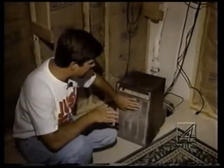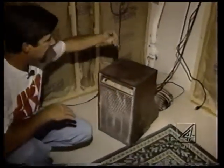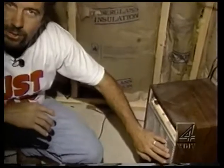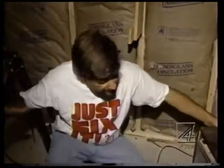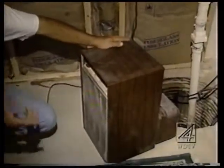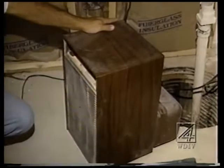The principle behind it is it's going to draw in air through the front, and it's going to drop the condensation in the back. We'll get into that. But first, I want to let you know, you need to clean these dehumidifiers every season, whether there's a filter of sorts, because as it's drawing the air across it, it's drawing dust particles, insulation particles, all types of things, and it will clog it up, and it will hurt the efficiency of that.